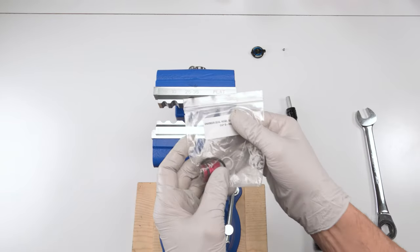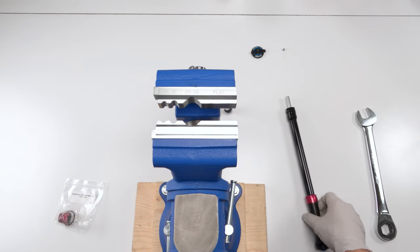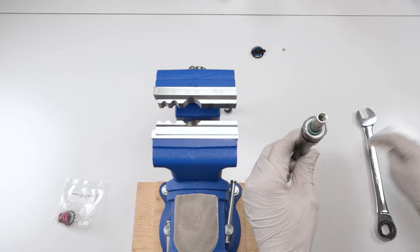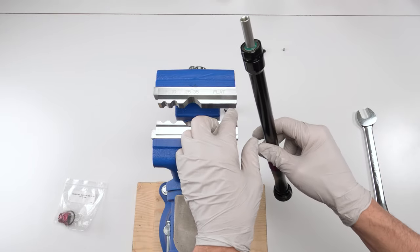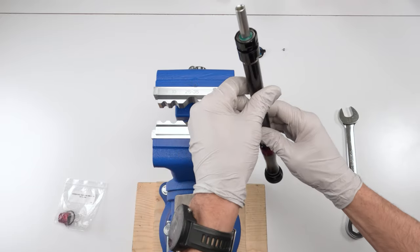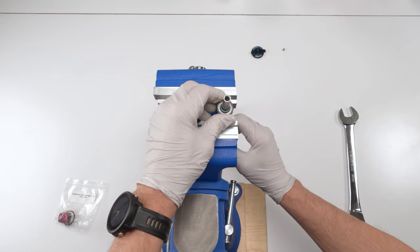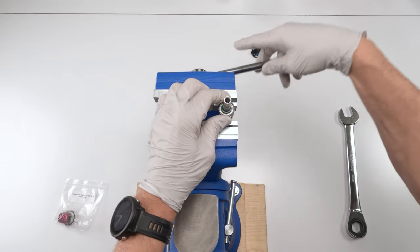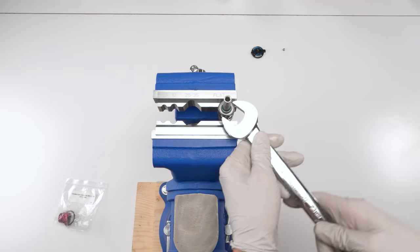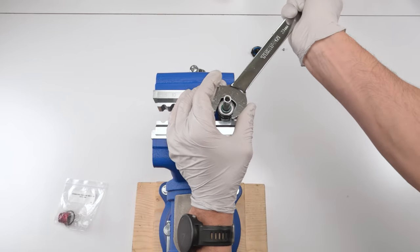Okay, before we continue, make sure you have your Charger seal head kit from your 200-hour service. Put it on the side, right? So again, RockShox made it easy for us. Flat, soft jaws, all that's needed in order to take off the seal head, right? That and a 23-millimeter wrench. So we're going to take the flat sections of the shaft body, right? We're going to put on our soft jaw. And then we're just going to take our 23-millimeter, and counterclockwise.